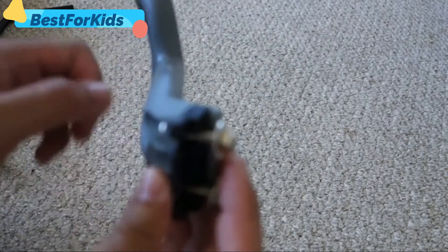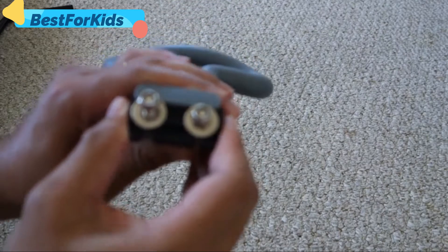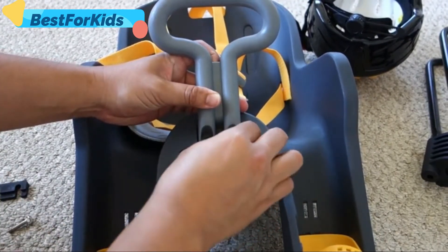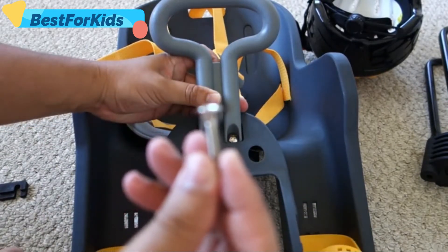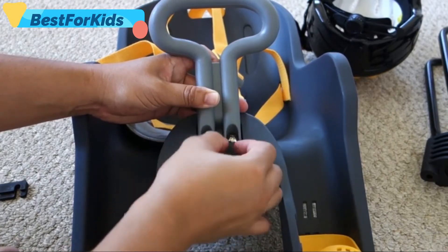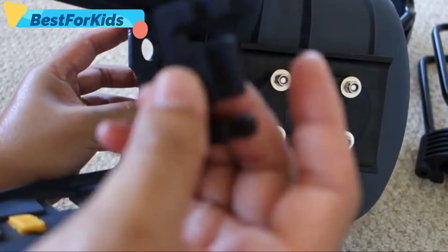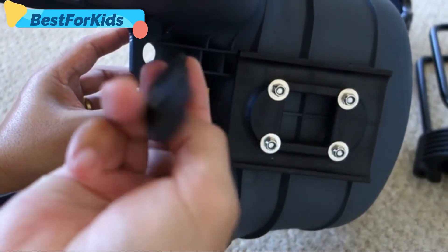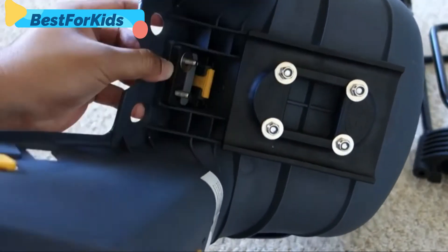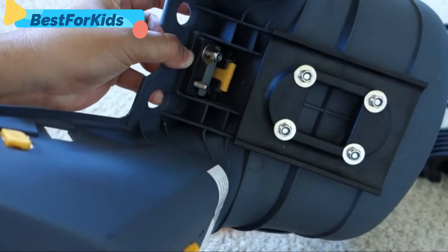This is your child's handlebar. When mounting it, you'll need to flip this plastic spacer the other way. Put it in and insert the screws with the square attachments. On the back, you'll need to flip it over to get underneath and align the notch in the spacer with the notch in the seat. Slip it in, put on the washer and the nut — these are 10-millimeter nuts, so you'll need a 10-millimeter wrench or socket wrench to tighten them down.